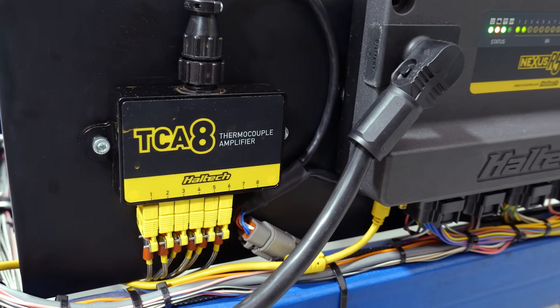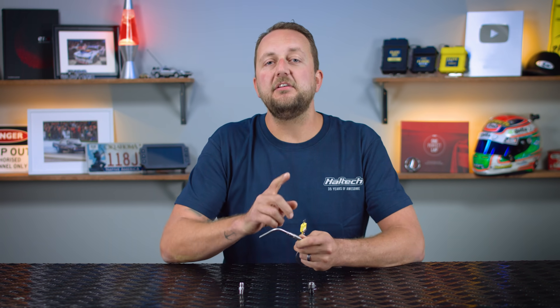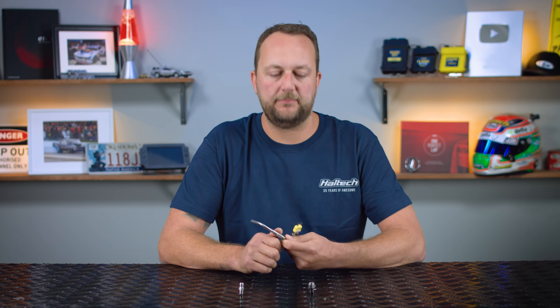The K-type thermocouple requires an external amplifier to get the data into the ECU. This is because the thermocouple itself outputs a voltage of around 60 millivolts across its almost 1500°C working range. The amplifier is there to convert that tiny voltage into data we can use in the ECU. So why not build it directly into the ECU? Well, each EGT uses two wires, so we'd need to chew up 16 ECU pins for a conventional eight-cylinder engine. ECU pins are always at a premium and not every installation uses them. Along with that, the electrical connectors and pins would need to be made of specific materials in order to maintain the integrity of the signal.